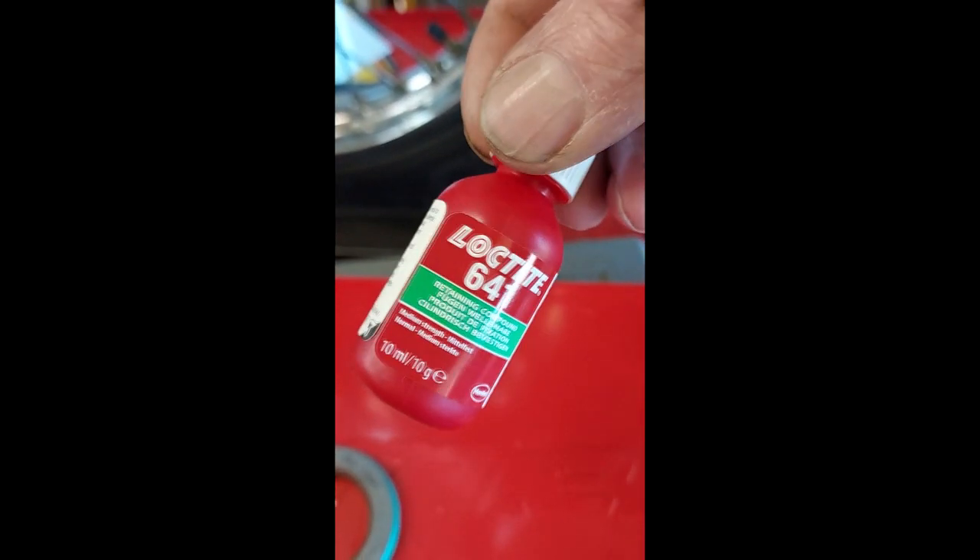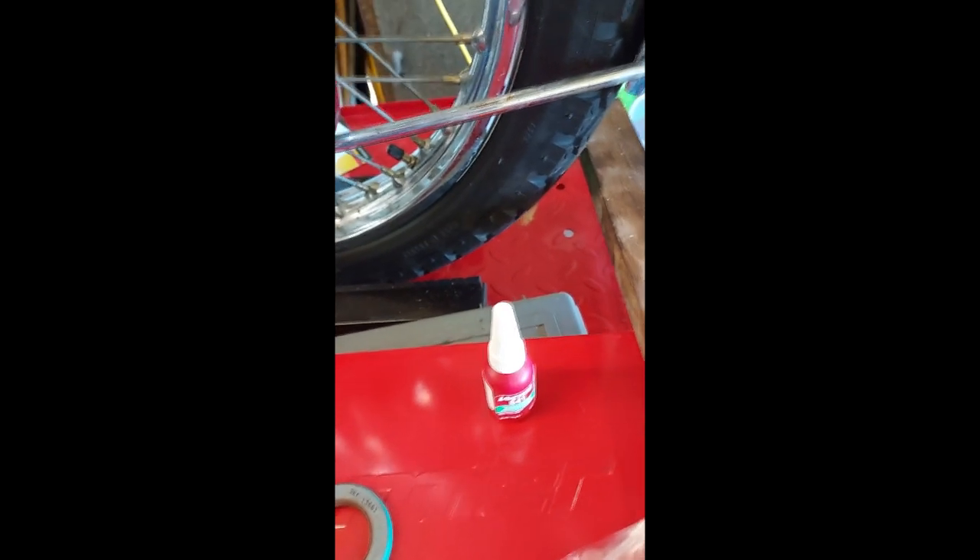This is the new oil seal that has to go into the crankcase. I put some Loctite 641 bearing seal around the outside, then I've got a lump of wood to drift it into place. I've already put the three rivets that were provided into the tiny breather holes in the crankcase. They were a little bit fiddly to get in but I managed to knock them home with a very small hammer.